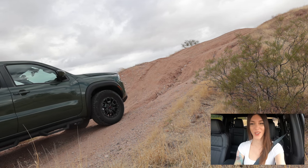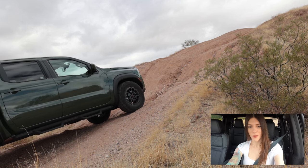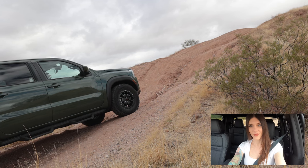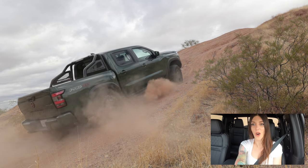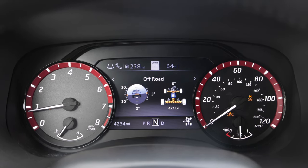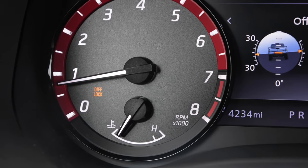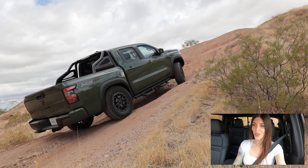Why is it not letting me go any further than the bottom of the hill? Let me turn off traction control. What is this? I'm in four high — why won't it get up this far? The robots are freaking out. I got stuck at the bottom of the hill. This thing will not even climb this. Why are the robots so intrusive on this truck? Put it in neutral, put it in four low, I'm gonna lock the rear diff. You gotta be moving under four miles per hour for the rear diff to lock. There we go — rear diff is locked. Now let's see if it'll climb the hill.